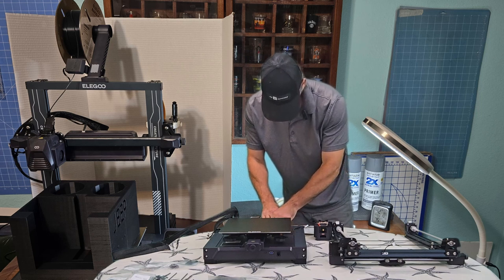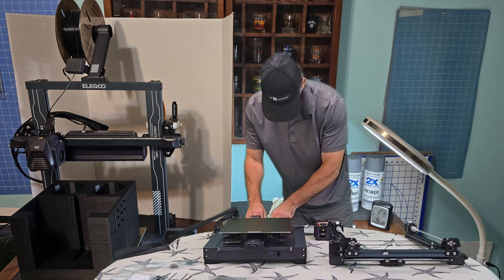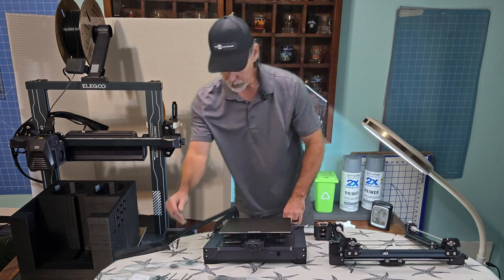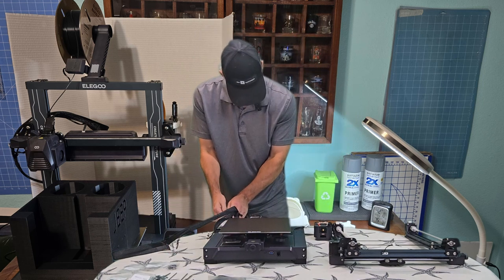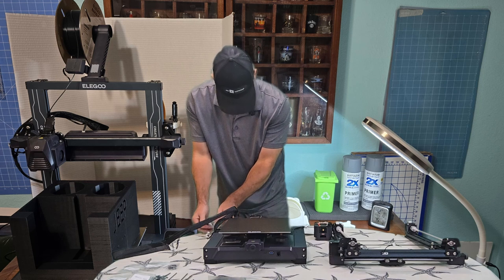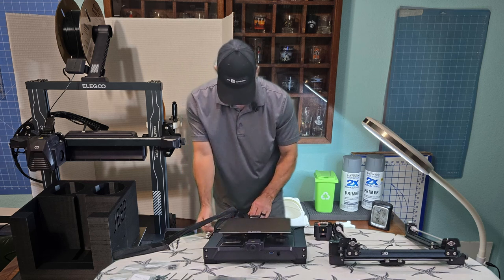Attach the printhead assembly using these two screws to affix the printer head through the holes of the cable strain relief bracket to affix underside of the printhead. So we are going to need all of those. So I'm going to dump them all back out. It says, and hope I don't drop none of them.